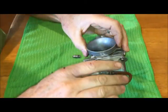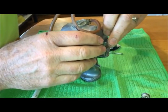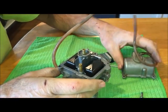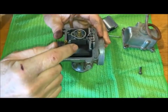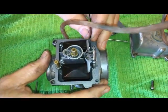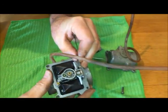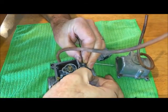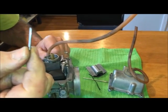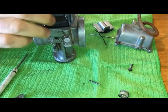Now to get to the two jets, I've got this float bowl ready to come off. You've got four Phillips screws, and if the previous owner was a hack, they're all stripped and you'll probably have to drill them out. Be careful walking around with this part — you've got your float seat here and it's a very tiny little rod right here that holds the float in. If you're walking around with a carburetor and you turn it sideways, this pin can fall right out. If you drop it somewhere you didn't know you dropped it, you'll probably never find it.